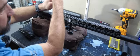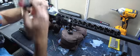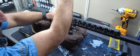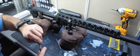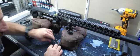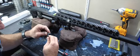At the moment I don't have one, but you can tighten the rear bolts to about 10 Newton meters, and then the front to about 15 Newton meters. Remember not to over tighten it. If you strip out the threads, it's going to be a lot of work and a lot of effort to get the replacement parts, get it fitted, and it's going to be a few bucks unnecessary out of the pocket.